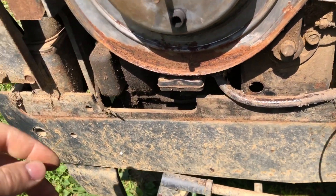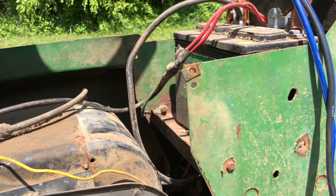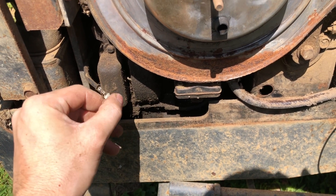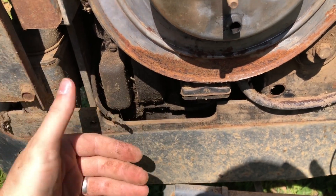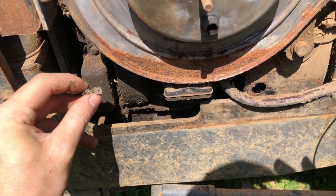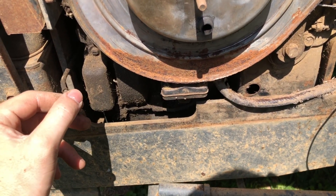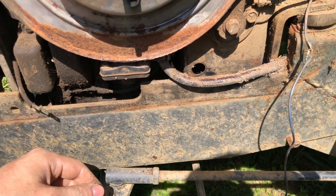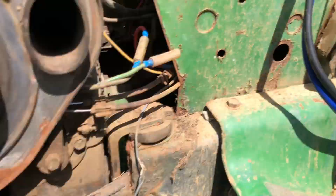I'm a little afraid because who knows how long it was like that. The previous owner basically pulled it from someone's yard - they were scrapping things and offered it to me. So we have no idea of the history. Whoever was driving it, it probably wasn't charging, just sat there and the magneto probably shorted into the frame, causing no charging of the battery and possibly killing the magneto too.